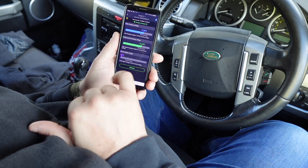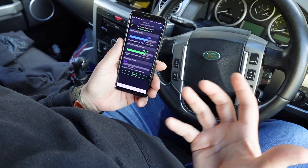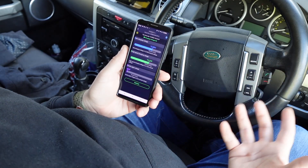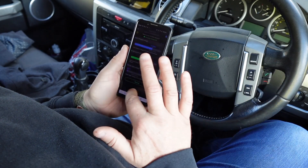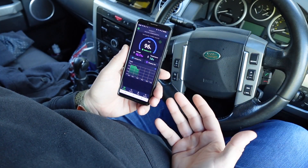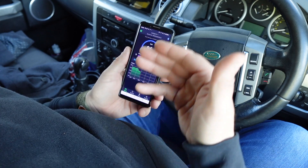I know we probably have this information on our OBD reader, which we also carry in the vehicle, but it's nice to have it just at your fingertips. And if you haven't got an OBD reader, what a great function to have all that information available, as well as battery monitoring. Old school, you'd have a battery monitor on your dash just to give you an idea of how your batteries were going. Don't forget, you could link this to an auxiliary leisure battery on a split charge system — it'd still give you the same information. It wouldn't give you cranking data, but it would give you the low-drop alert. So it is a handy tool for that, and it's on your phone with alerts.